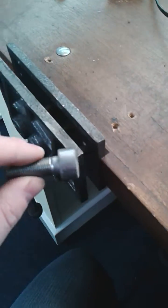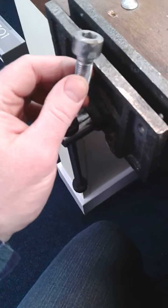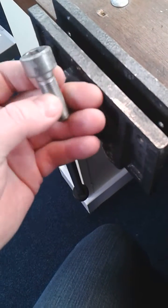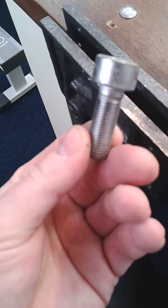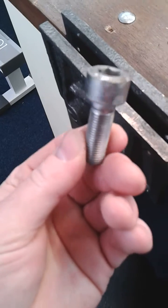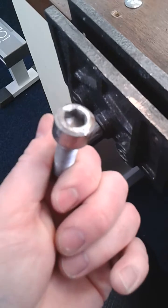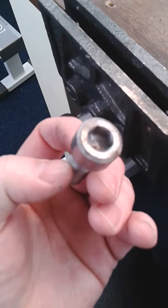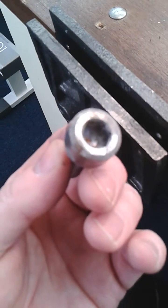Now, it's a good idea to lock the part down firmly in a vise, so you've got your hands free. So I'm going to pop that in a vise here. It's only aluminium, so if you do use a vise, just don't over tighten, because you will damage the screws if you really over tighten it. It takes a lot, but it's probably better to put a cloth in there, which I'm going to do now, just to protect the thread. And so we'll set that up in a vise so it's nice and firm to work on.